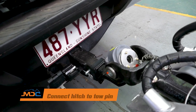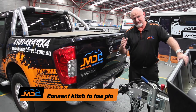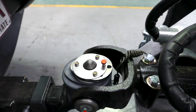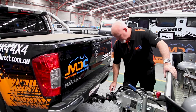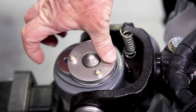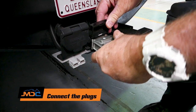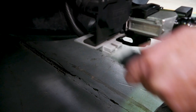On hooking up from your van to your car, we have a DO35 hitch — all the same on the XT range. It's just the pin that goes underneath it. Once you're over the top with the jockey wheel, you wind down as far as it goes. Once the jockey wheel becomes loose, all ball weight is here. Push the red button — that means it's locked on. Once this button is pushed and this little R comes forward, that means it's locked on. To get it off, push the button down, push that back, release the button, and you open up the throat, then wind the jockey wheel off. But we're hooking up at the moment, so button down, then 12-pin plug — plug that in just there and secure it. Your Anderson plug, 50 amp, charging of the batteries — plug that in.